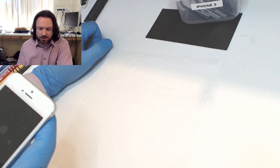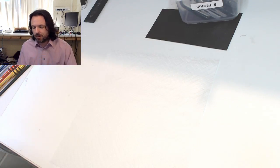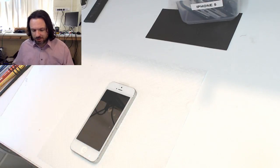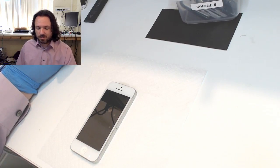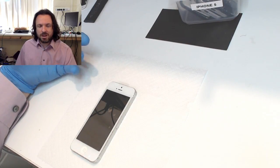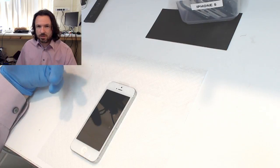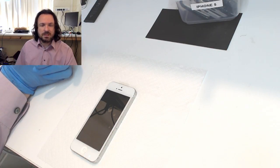The only trouble I'm finding with things like the 5 is the refurbs are starting to get batches of pink ones, and the pink usually means that they've been refurbed too many times, so I'm kind of tossing up whether I should start picking up the high-end aftermarket ones. It's tough to say because I find with the high-end aftermarket ones, the screen sometimes can be good enough, but the touch almost always has issues.